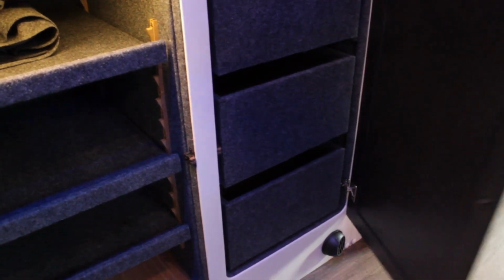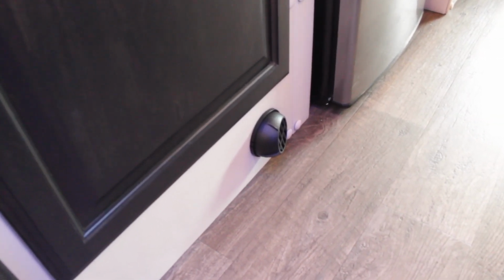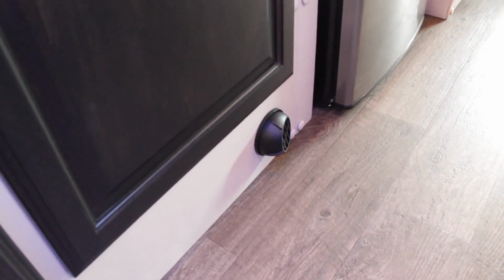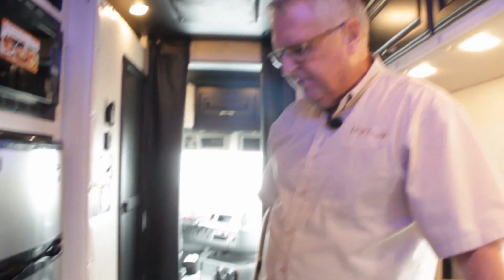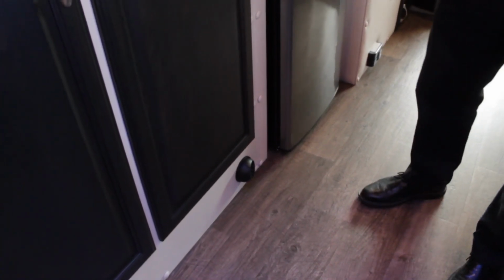While we're looking at this cabinet, I want to show you one other feature that I include in my trucks, and that's a fuel-powered heater, so that I don't have to run the generator with an electric heater. I get my heat from it. It's a company called Webasto. Some people are familiar with a competitive company, Espar. I'm using the Webasto brand. That's what Volvo puts on at their factory, so that's what I'm installing here. You can see that we can now have heat in the truck without running the generator. It saves time and expense on the generator.